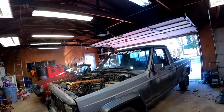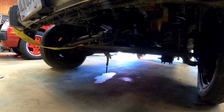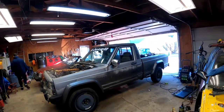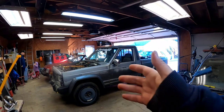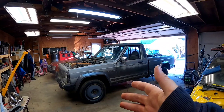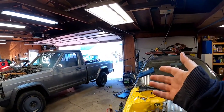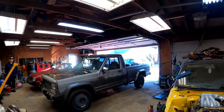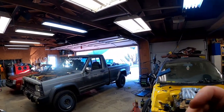And I don't have to worry about a lot of suspension alignment stuff because these things are actually still technically a solid front axle. So they're really easy to swap to 4-wheel drive, and that makes doing the front super easy. The front is literally just a set of springs and a set of shocks, just springs if I really wanted to be cheap. And the back is a set of 3-inch drop blocks and a set of XJ rear shackles. Super simple.